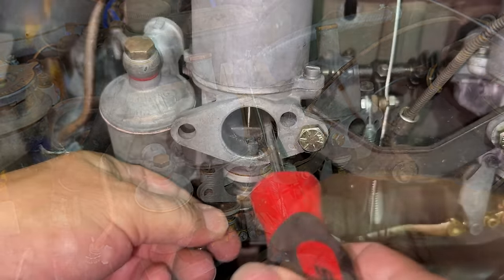I did order a pair of the original air cleaners. Note there's a little hole that is a vent the carburetor needs — this hole needs to line up with the holes on the carburetors, or you are going to have problems. On a Bug Eye it's important to have the air cleaners because the bracket holding the choke cable is held on with the bolts that hold the air cleaner. The new air cleaners are on and it looks great. We are not going to start the car and tune it this time — the starter just went out. Next time we will start addressing some of the electrical issues.